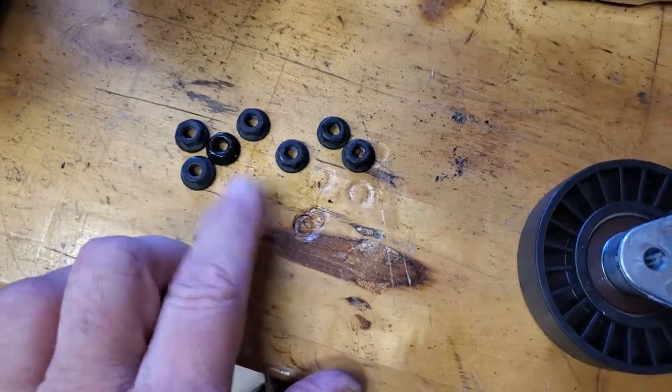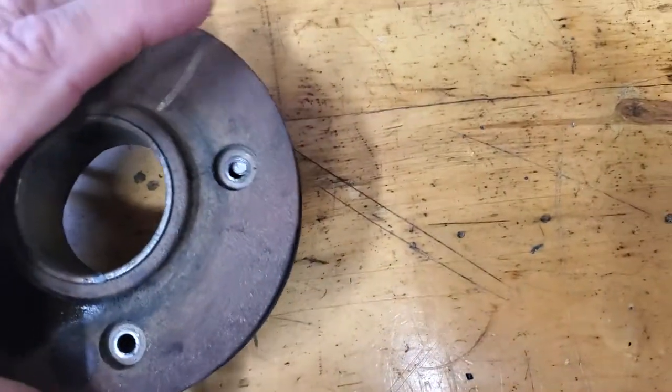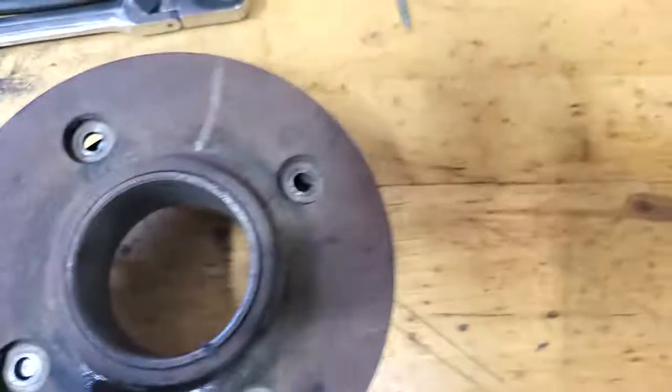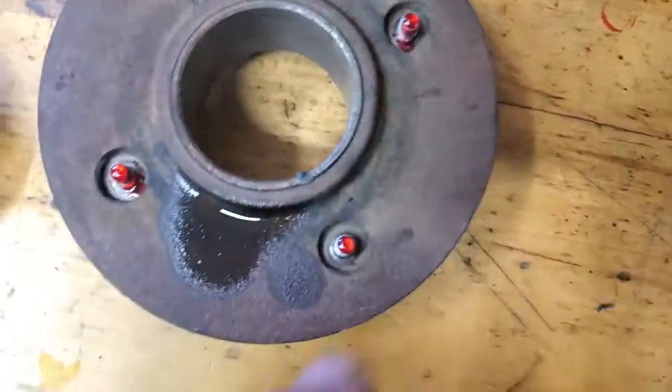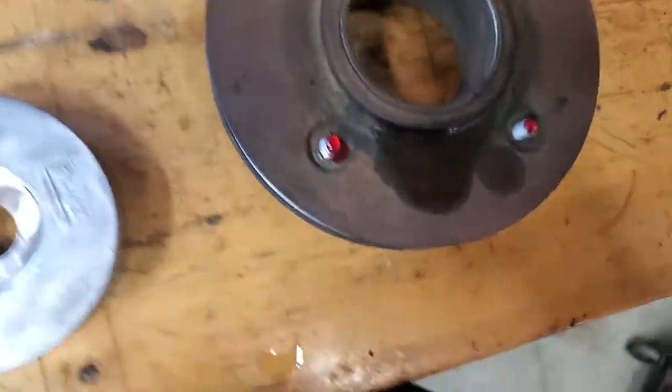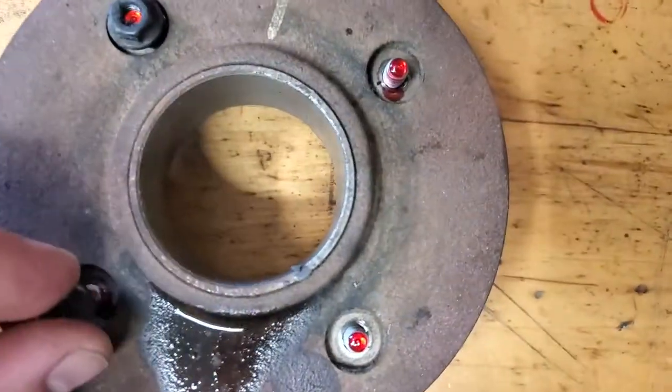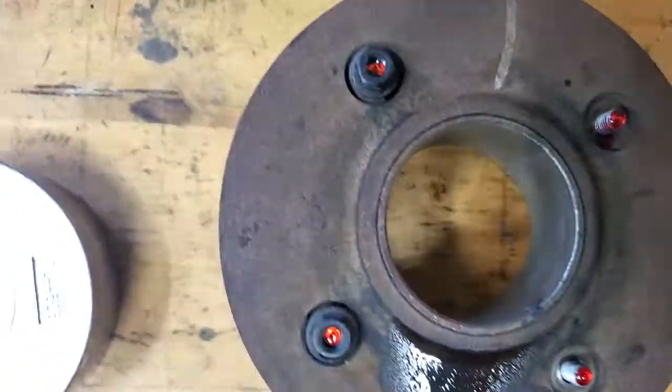We're missing — two, four, six, seven — we're missing one nut. Remember in the other video, these four nuts were missing, so that's not a good thing, it's one of the causes. We'll make sure we use a blue Loctite. I couldn't find my blue, so we put red Loctite on it and we'll take and tighten these bolts up. I don't think I have to show you that they're 10 millimeter.